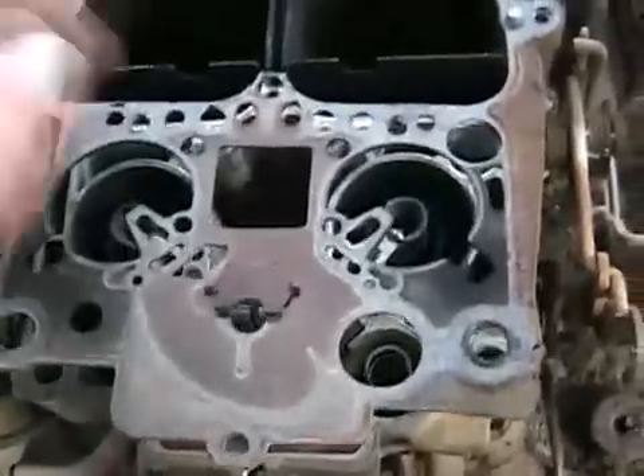Now to put all the screws in, all the way around. They even slip two screws way down in the abyss that you have to find and put in. Now all the bolts are in. This is the little adapter that holds the crappy little fuel filter, and that's the spring that holds the fuel filter against it. I've just scraped out all the rust in there. Always make sure when you put this back together you've got your little nylon gasket on there — you can barely see it — because if you don't, gas runs out here, slowly seeps, gets on your hot exhaust crossover tube which actuates the riser on the choke, and then your car catches fire. You're just driving along, it's still running good, but the motor's on fire. So always make sure that gasket doesn't fall off.